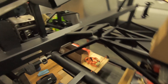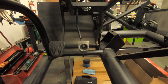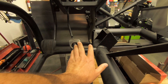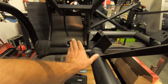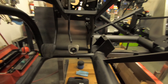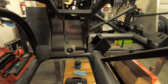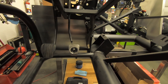Part of my reasoning is that I want to be able to heel-and-toe downshift. Heel-and-toe downshifting is where you apply the brakes with the toes of your foot while simultaneously blipping the throttle with your heel or the side of your foot - sometimes it's more like the side of the foot rather than the heel. This lets you apply brake pressure while downshifting into a corner so you can exit the corner in the gear you want.